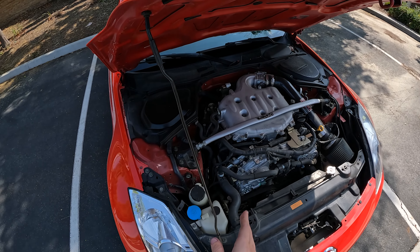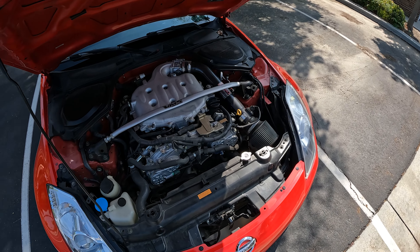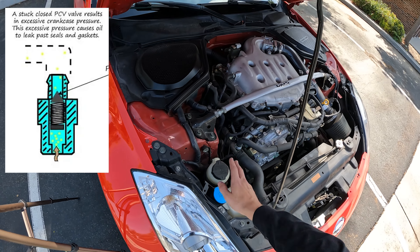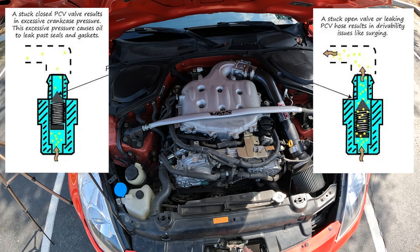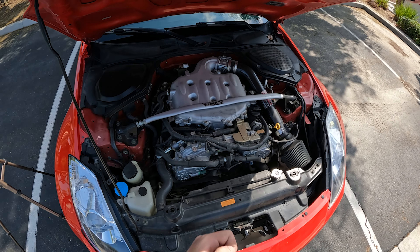Right here is the PCV valve. If you're not familiar with it, it is the positive crankcase ventilation valve. As your engine is running, it's creating pressure inside. Your PCV valve is basically a one-way valve that lets pressure escape back into the intake. It also carries oil fumes and stuff — instead of venting to the atmosphere, it sends it back into the engine to be reburned. A lot of times the PCV valve will be plugged, the ball valve inside gets stuck, and because pressure can't escape, your seals and O-rings have positive pressure pushing against them, which can cause premature oil leaks and seepage.